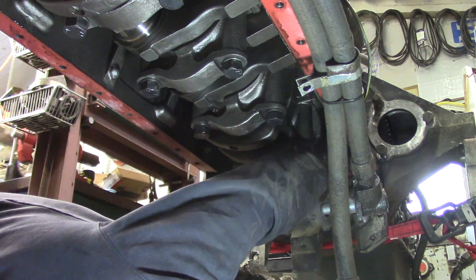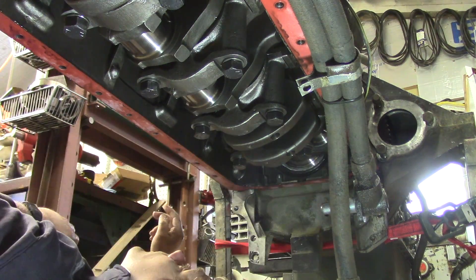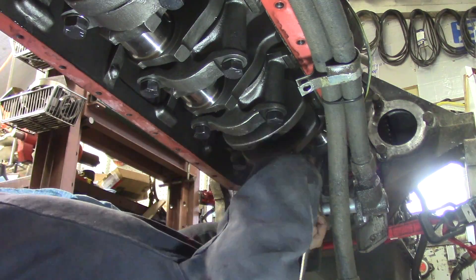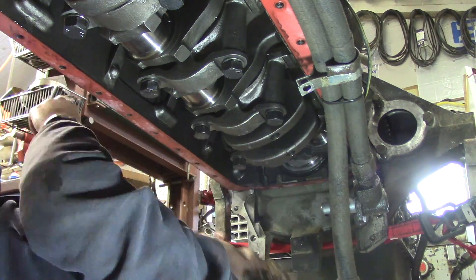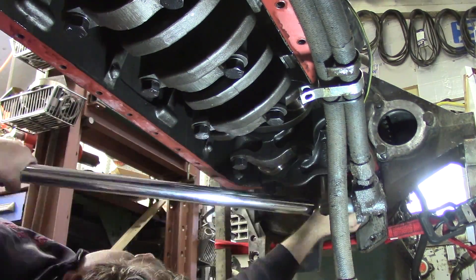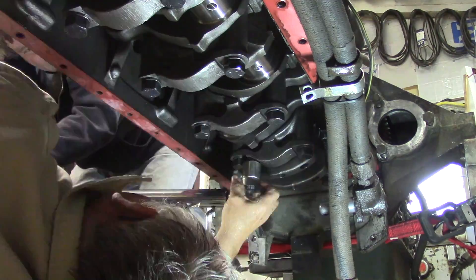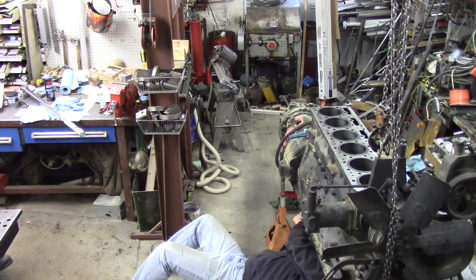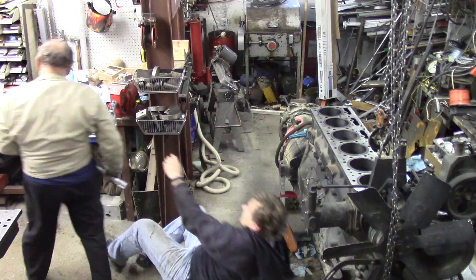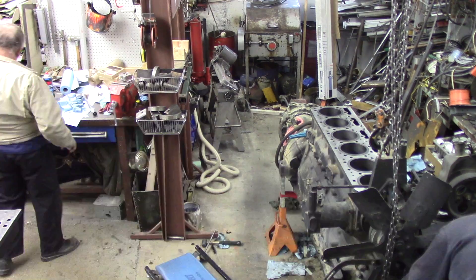Getting number seven in is its own special kind of frustrating because it's the thrust bearing. I could get the top bearing shell and the two thrust washers in fine, but I levered the bearing shell in place and stuck the end towards the front of the motor to the crank with grease, then flew the back thrust washer in with the cap itself and managed to get it all in there together in one shot. Torquing them up works great with two people because it's 275 foot-pounds — we used a big torque wrench, one person held it and the other snapped it.